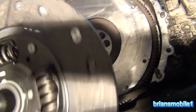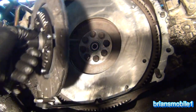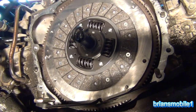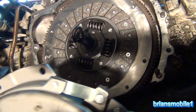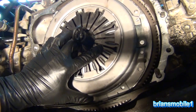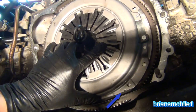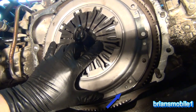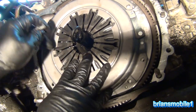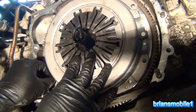The first thing you do is look at your disc — it'll say 'flywheel side' right there. So you take this, just put your pilot tool in there. You've got the alignment pins and the bolts, so just find where it lines up — makes everything happy. Just take your bolts and put them in there. I have no access once I get the camera in there — I'm leaning clear out from the cheap seats to get this in. Put the bolts in by hand.